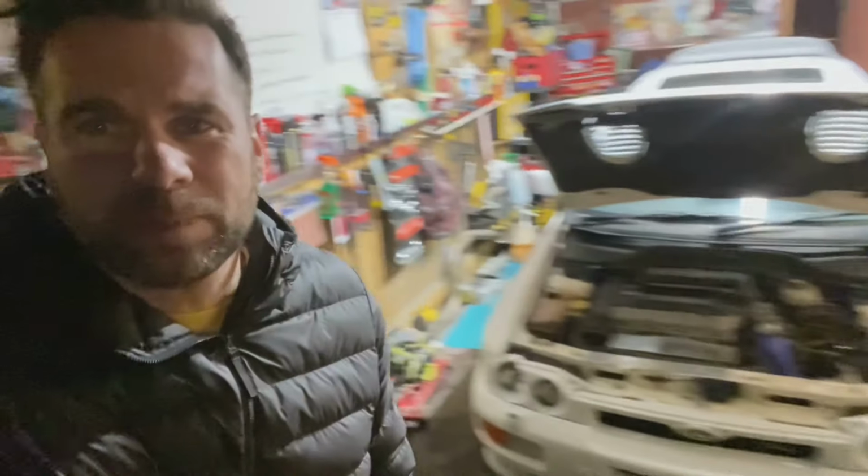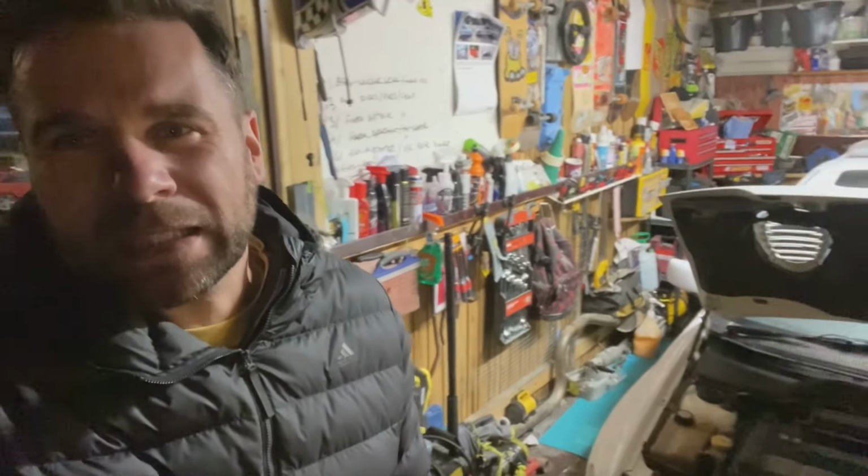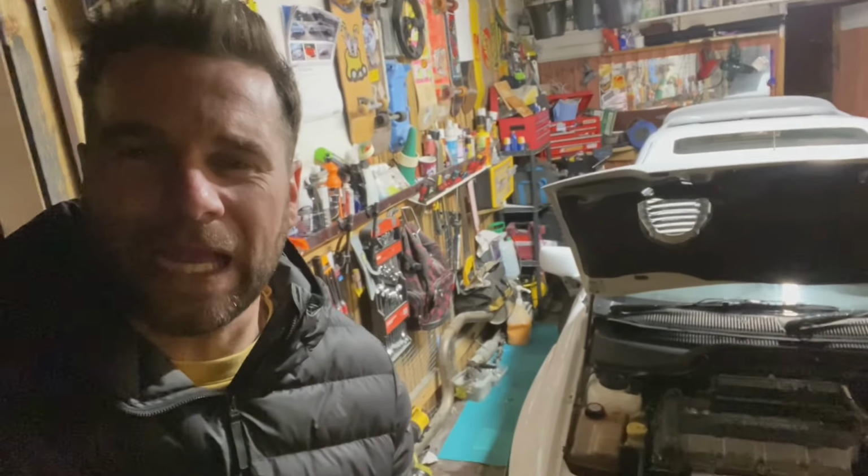Out in the car, we've done some pulls, we've done some miles, but parked up, the temperature is still under 90, it's about 88 degrees I think it read. I parked up and I see a bit of water dripping out, so I was like, oh god, no, the pump's knackered, but it's not, it's coming up the top of the expansion tank. So as I said, the car's supposed to take 7.5 litres, it took 7.